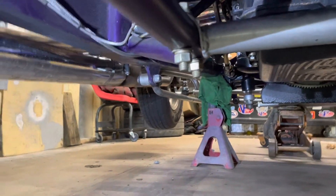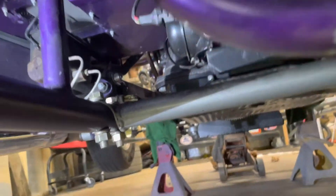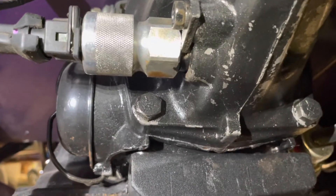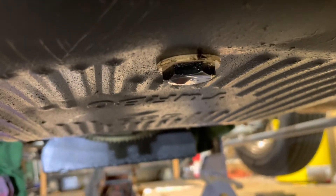All right, slowly moving forward. Been running the brake lines, checking to make sure I don't have anything leaking on any of those — so far all of them are fine. Transmission is completely dry down here. Sensor's not leaking there. I might have a little drip right here — I had a drain plug right there, so I might have to snug that up a little bit.